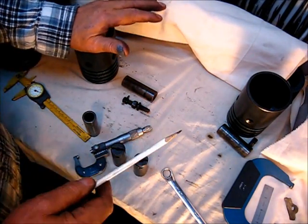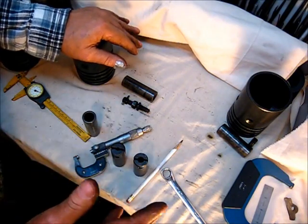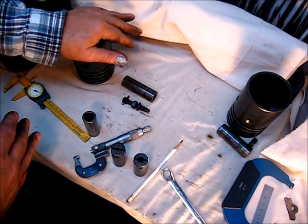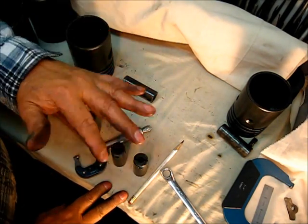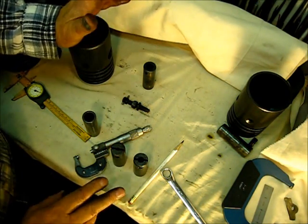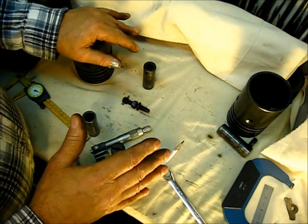These are low-speed engines — about 600 to 650 RPM. Most owners tend to run the engine slower, which in my opinion is the correct way to do it; no need to overrun it for no reason. You need a different grade and type of oil for a slow, cold-running engine compared to a high-speed, hot-running engine — the oil is just not interchangeable. And if you run these engines at a higher speed, they do tend to be out of balance.